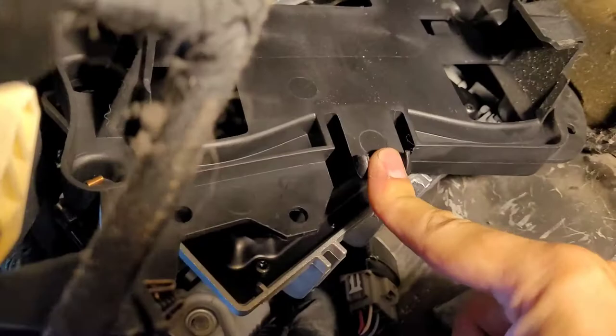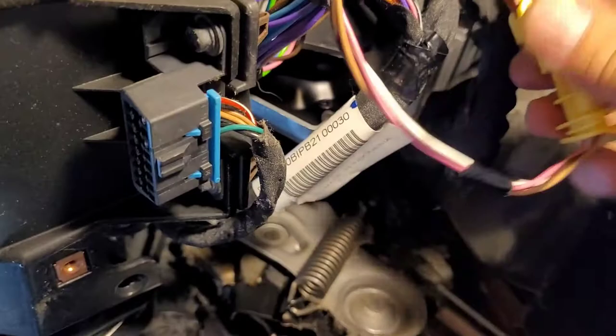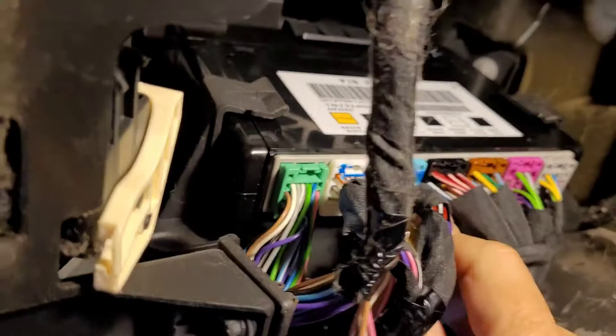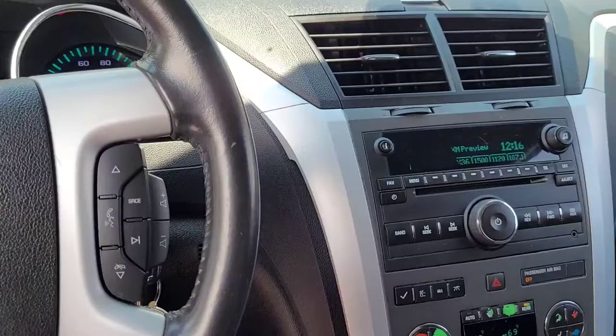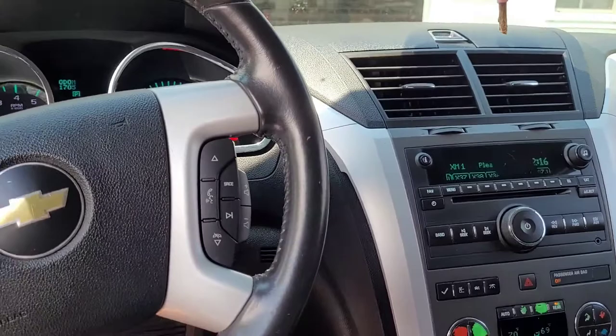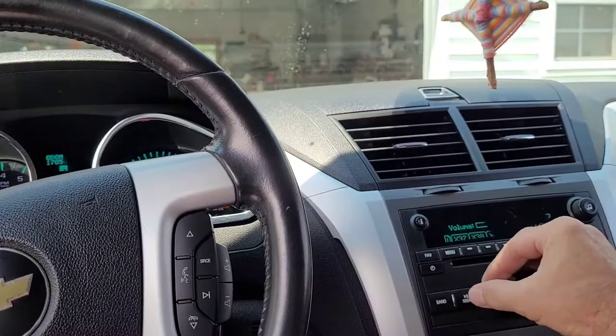All that's holding the BCM in is this little tab right here — just pull it back and it slips right down out of the sleeve. Slip it back up in there, just like that, locks right in. Stick the airbag plug right back in its little holder. I'm gonna get the battery hooked back up and turn this on. The car's been running and the radio has been playing for 15 minutes and it hasn't gone out one time, hasn't popped, haven't lost any sound. So we're gonna pull it back in here and finish putting it back together.